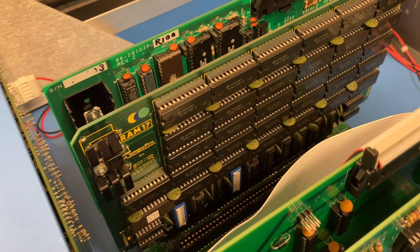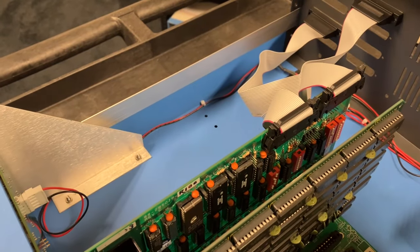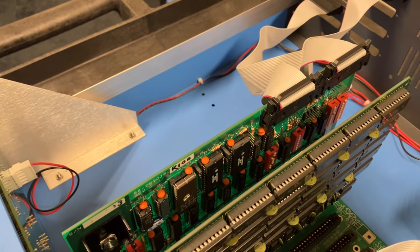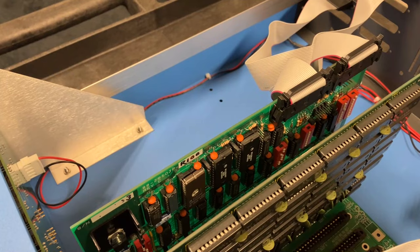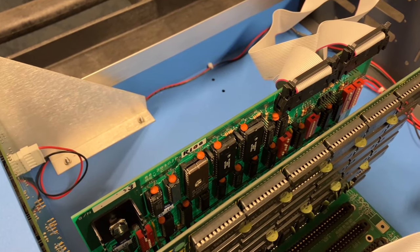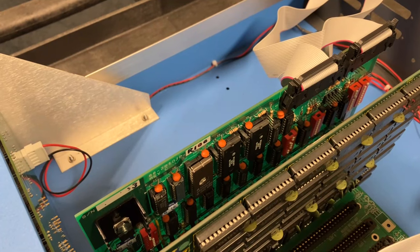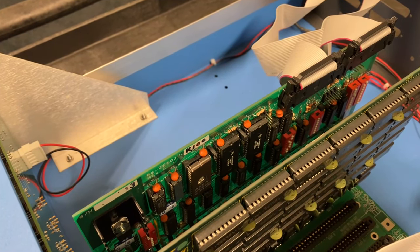But for this first demo, I'm going to use this EEPROM, which I put a serial bootloader in. All right, and then finally, like I said, we have the 2SIOJP because it can go at higher baud rates. And we're running this at its max baud rate, which is 76.8 kilobaud. At that baud rate, this performs basically the same, in fact, a little bit better than original CPMs for the Altair did on original hardware back in the day. So it's a pretty nice system. Given that you don't have a disk controller or any of these other items, it's a nice running CPM.